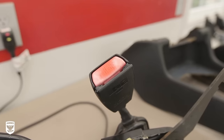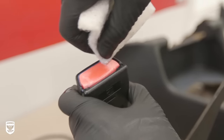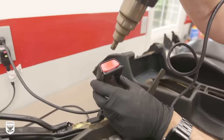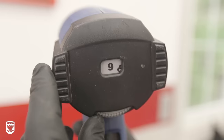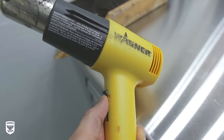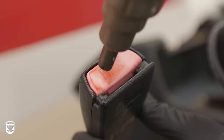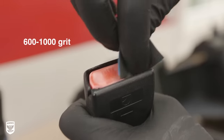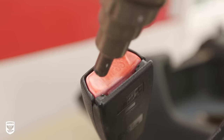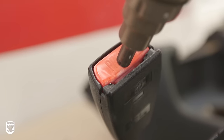Then Brian showed me a cool trick to repair faded red seatbelt release buttons. He first scrubbed the plastic clean, then slowly heated it up with a Steinel HL1910E with a direct nose cone for precise heating and a number wheel from 9 to 1 for an exact temperature setting. Typical high and low settings lack the precision needed for these types of pro repairs. He then sanded the tight spots with 600 grit and repeated the steps with the heat gun. This is a very effective process but wildly unforgiving if you overheat the area, so if you choose to do this, work slowly.